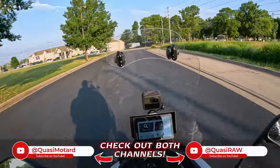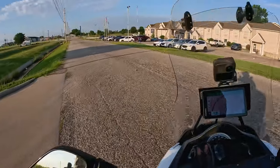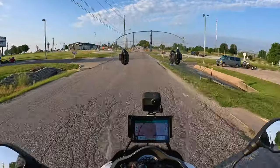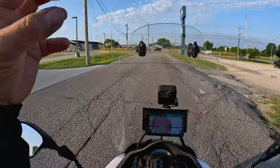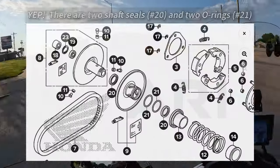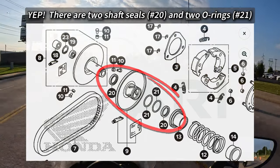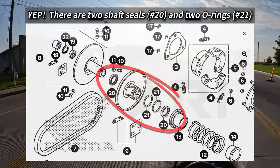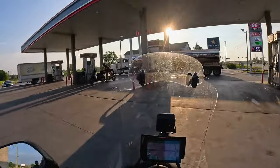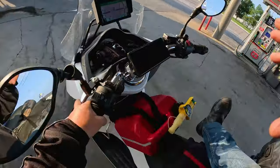So it was my torque drive in the back that's been the problem for a very long time now. And I kept attributing it to the variator and everything else. I knew that the contra spring in the back is probably an issue, but it was more likely the spline. It was like a telescopic issue, you know, where the pulley backs itself off. I've never really looked at an exploded diagram of it, but there must be an O-ring or something in the center that keeps all the grease and everything in the bearing assembly in the torque unit itself, and that O-ring must be gone because it was puking all of its grease out onto the inner part of the CVT housing, the belt and everything else, and it was creating all my issues, as well as the low end, you know, bogging, not getting off the line.